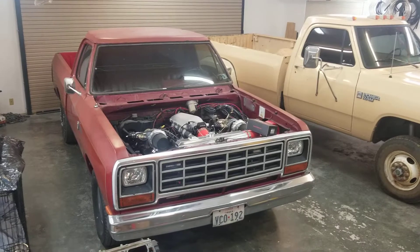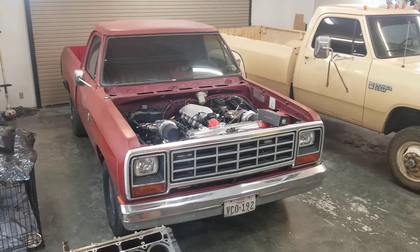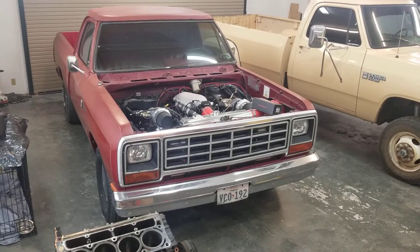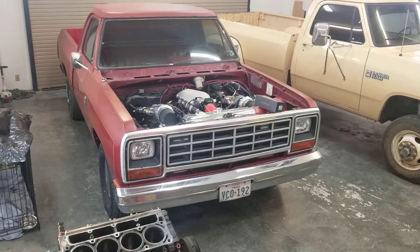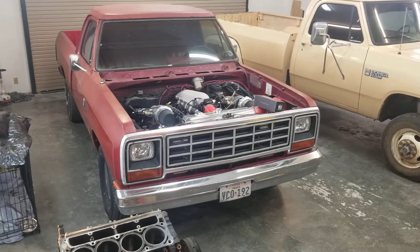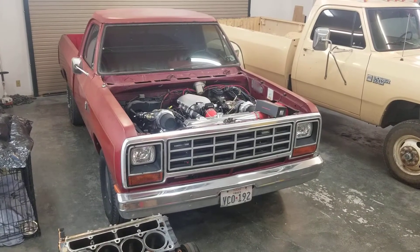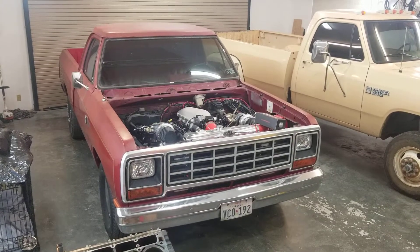Certainly the Micro Squirt is affordable and capable for what it is. I'm going to put down almost 800 horsepower on an ECU made for snowmobiles, so it is doable. The things that aren't going to work for me on Badonka: it doesn't have a built-in barometer, it can't adjust for altitude, and we're at 6,700 feet.